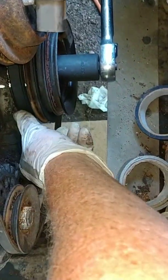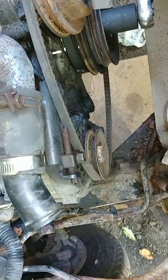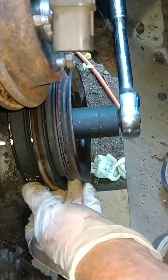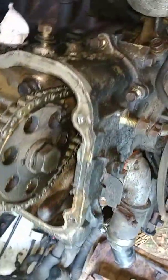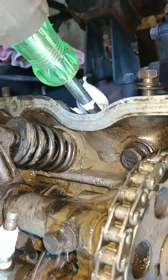This mark on the belt — don't pay any attention to that. It's just some extra paint on there. That's where you want to be on your top dead center. Now, if I stick my nut driver back in there, it should be right flush with the top of the valves. And it's right where it needs to be — that's as high as it goes. So I am a firm believer we are at top dead center right now.